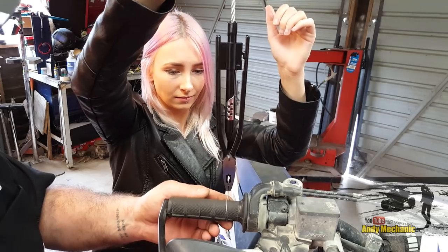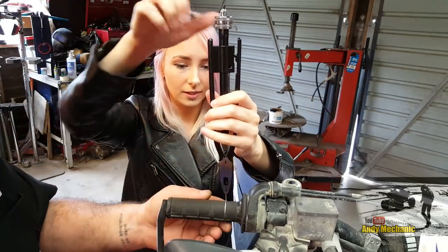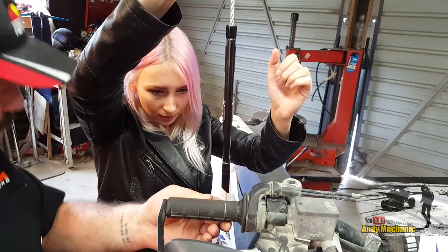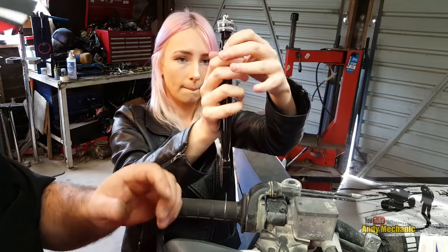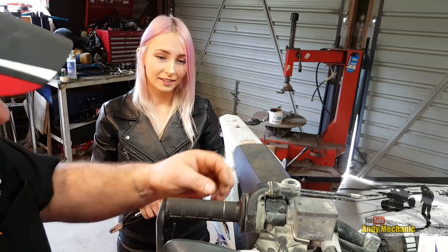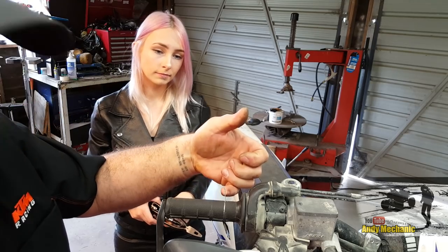Release that hand, give it a twizzle, then grip back on again. You don't want to overcook it because you can snap the wire — that's the only downside, so be careful. And you can see by using those pliers just how even a twizzle you get on the wire — it makes it a really neat job. You can actually use these pliers for doing lock nuts and for wiring the sump plug and so on for racing as well.